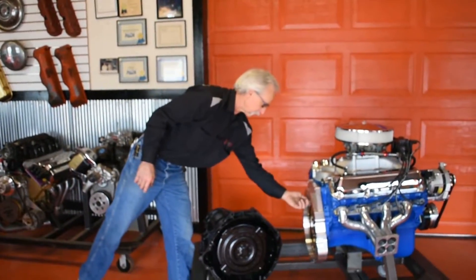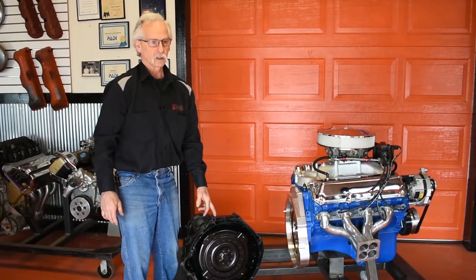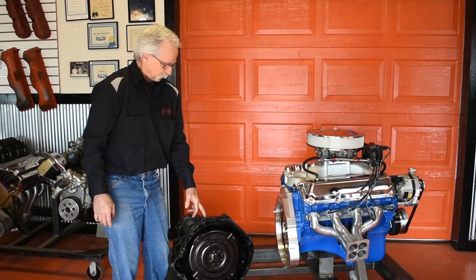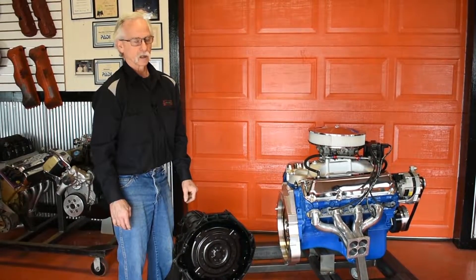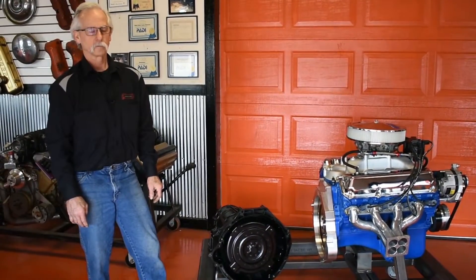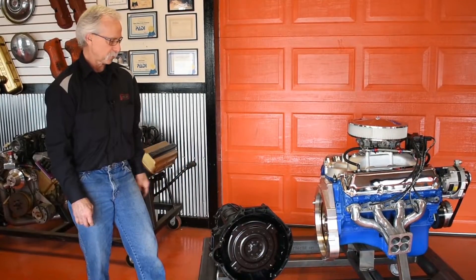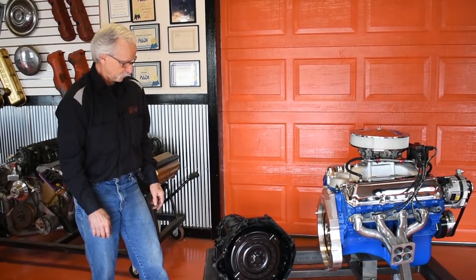You've got about an inch of space to take up, so we have a spacer for the torque converter for the 6R80. The 6R80 being used for this kit is the V8 style — there's another kit out there using the V6 6R80, but we use the V8 one, the 5.0/5.4 version. The 10R will likely fit too, but nobody has a controller out for it yet — when that comes, it'll also fit this kit. With slight modifications, we can use other modular-style transmissions like the 5R110, 4R100, and 4R70W. We're also working on a manual transmission version, which requires a custom flywheel.